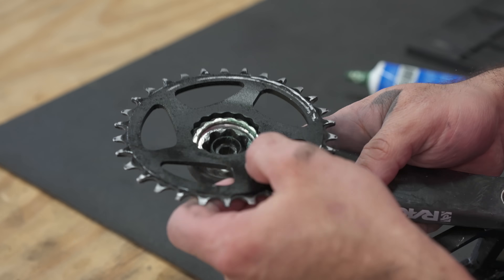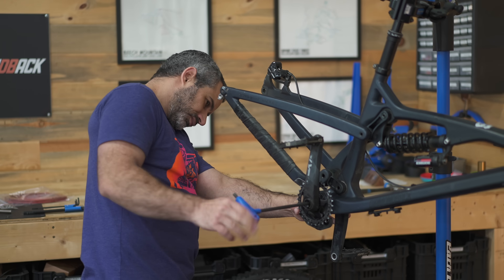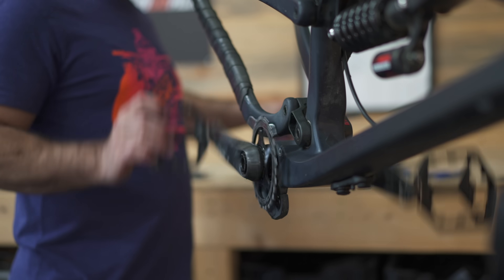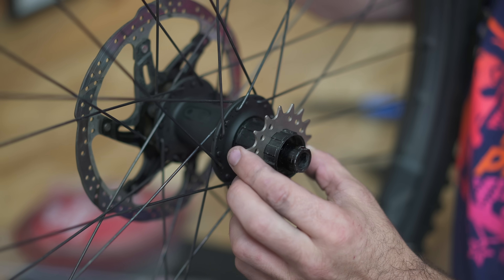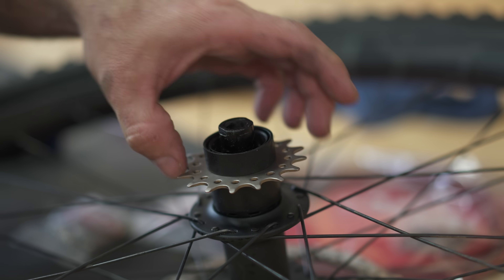Slope style bikes are usually either single speed or they have a downhill drivetrain — they're not really made for climbing. I had this oval chain ring that's made for climbing; we're getting rid of it and putting this round one on. Now instead of a cassette we're going to put one single sprocket. My gear up front is a 30, so I'm going to use a 16-tooth at the back — that gives us the gear ratio to be able to sprint. You're not really going to be able to climb with it. The sprocket slides on the cassette spline, so I'm going to have to put spacers in, and those are the ones I painted black. And we are done with the back.